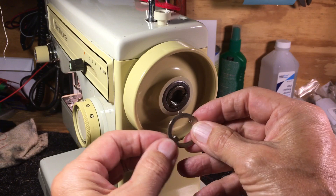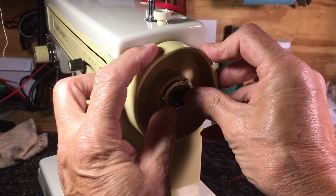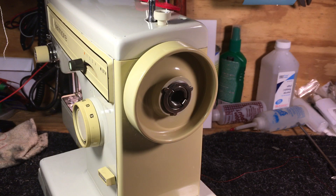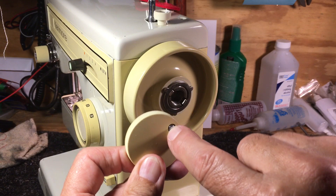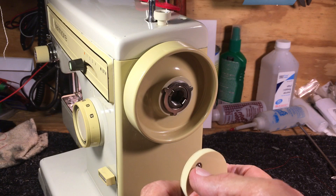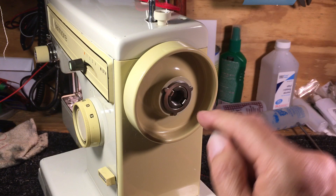As we put it on here, the little ears would be pointing in or pointing out. You want to point out. Those of you who know what 10, 2, and 6 is — this little clutch has six points. You put your little points out there and you notice where they are, because when you screw it back on, this little screw is going to end up between these little points that stick out. If it's on one of them or too close, it won't release.